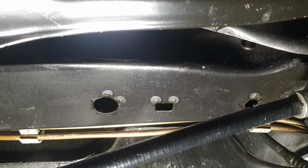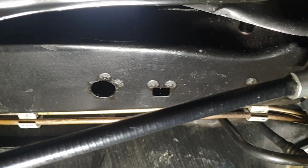Yeah, and then get under the car and have a look at the chassis members. So that there, that box section, that's a chassis member. They go there usually, sort of around about this point here. I think water must collect somewhere. Also, that's the fuel tank there, plastic fuel tank. So brake lines and fuel lines run between that chassis member and the fuel tank, and you want to try and get up in there and have a look as well.